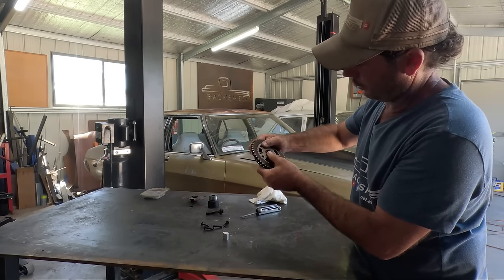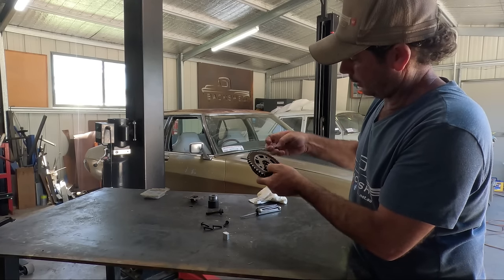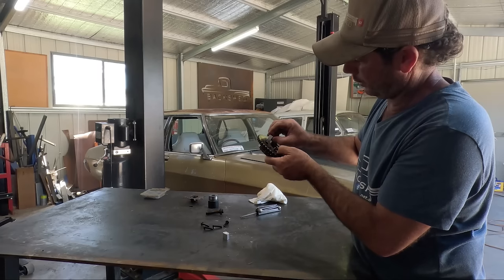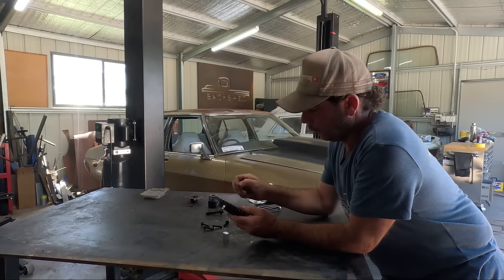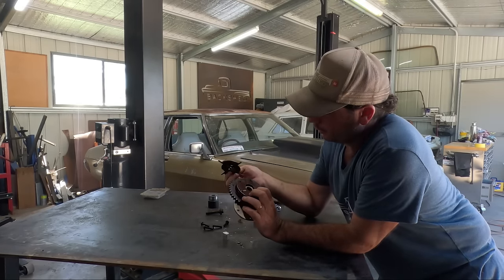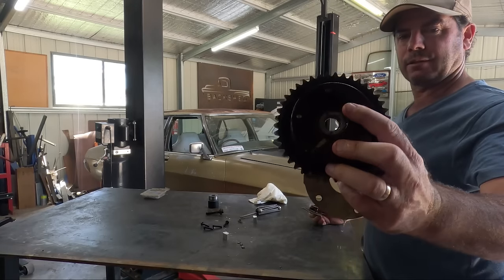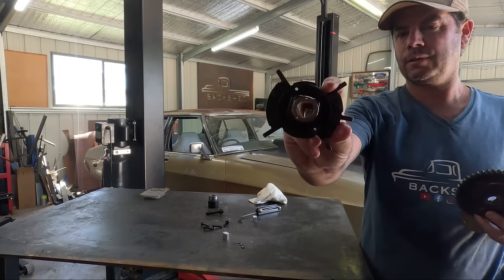Yeah, that phaser is shot. Those fins are just about cactus. Anyway, this will fix it. But that's not the main issue here. We can lock them out, no problem at all. But the reluctor has snapped those three little pins. See those three tiny little pins? They're only tiny, and that's why it's snapped off.